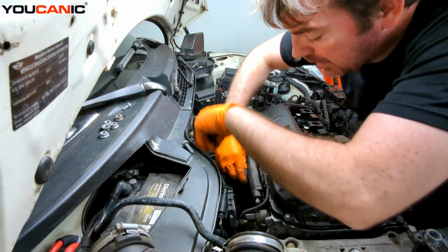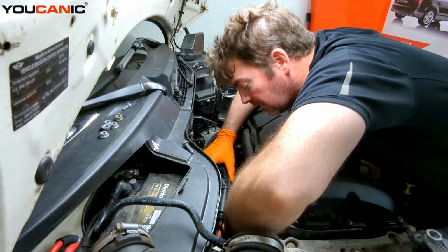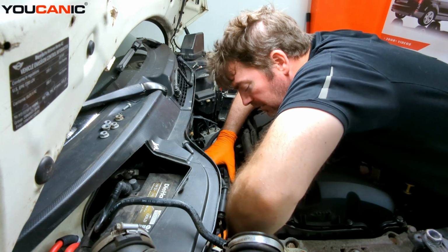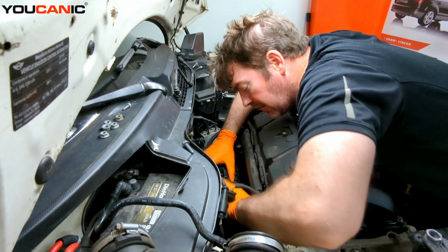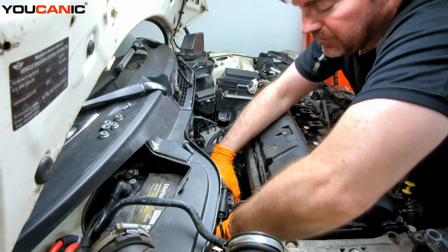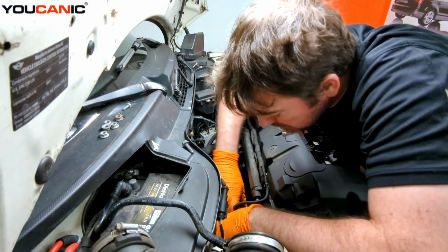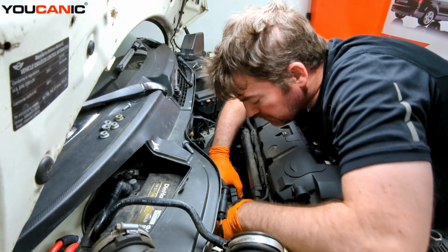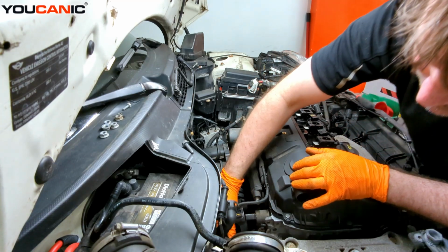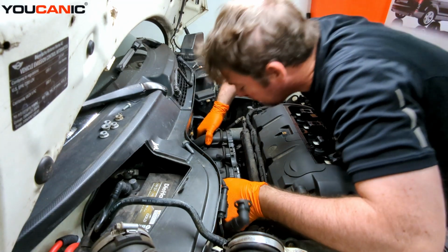Like I said, this fuel rail holds it up. So if you took the fuel rail off, it could potentially be a little easier, but then that's also more and more things you need to replace if you need to do that. So we line this up, press it until it locks, and then you're going to turn this up. So it kind of wraps around in through the manifold here, and then this tube will come up and connect right here. So with that done,